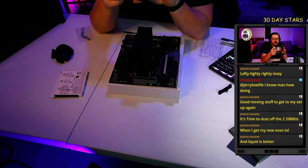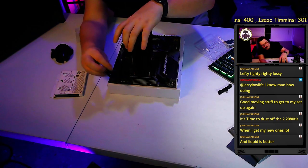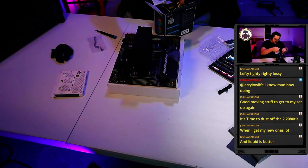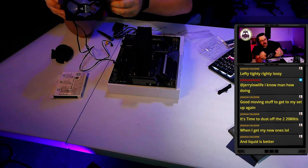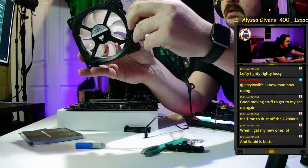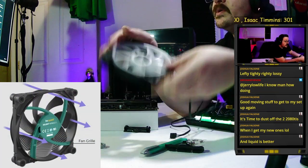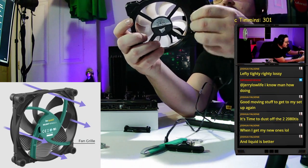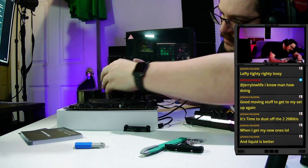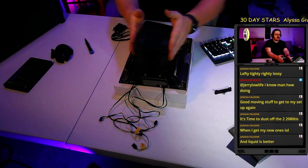When you stick the fan on, pay attention to where the wires go. I'm putting it so the fan wires are at the bottom so they can route out of the way. This type of fan is held on the cooler with small brackets and hooks. Most fans — the side with the cage is the direction the air exits: it sucks air in from the open side and blows it out through the cage side.